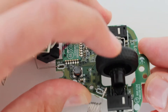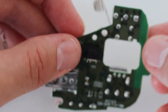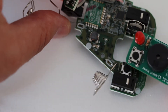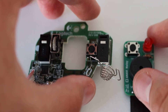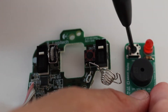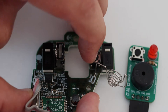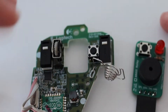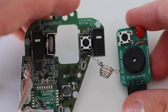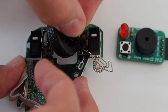The scroll also acts as a middle third button. However, if we look closely, the switch for the middle button is completely different from the micro switches for the left and right mouse buttons. It is actually the same push button used in a soldering kit prototype received from PCBWay — a very simple, low-cost, commonly used through-hole push button with 4 pins. When the user pushes the scroll, it makes contact with this push button, which may break over time, so eventually you may need to desolder and replace it if you want to repair the mouse.